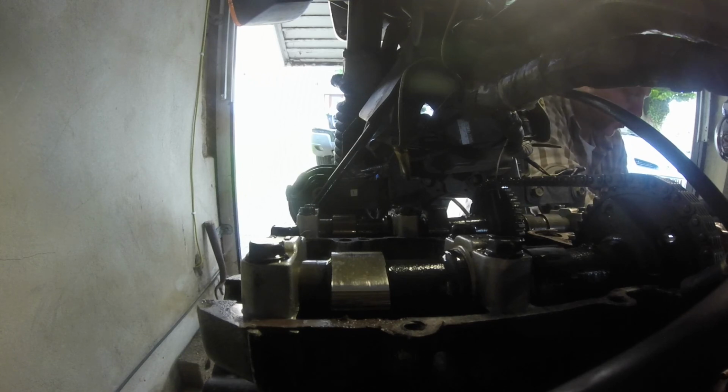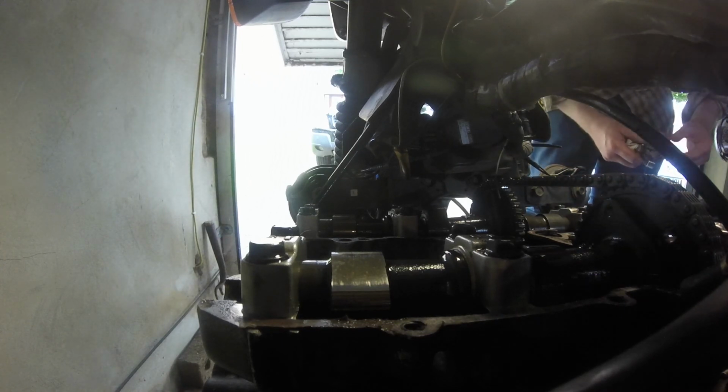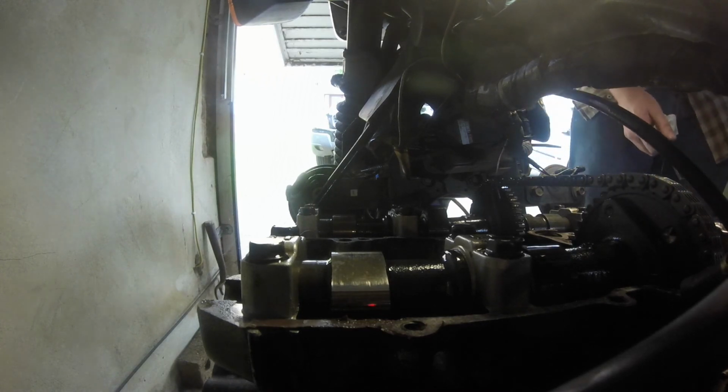Basically, you just get your lobes to a position where you can get your feeler gauges in between the lobes and the buckets, or followers, I'm going to call them. You can start in the middle of the range, but you've just got to choose a starting shim and just work backwards and forwards. Like I said, what you want is that ever so slight drag when you pull it out, as if it's just being held between thumb and forefinger, not being forced in, just that light drag, and that will give you your measurement. And you just go through the whole motor like that, valve by valve, till you get all your clearances. Simple as that, really. Right, I'll catch up with you back at the bench in a minute.